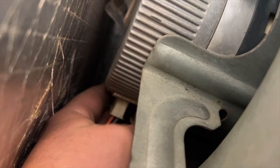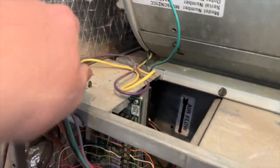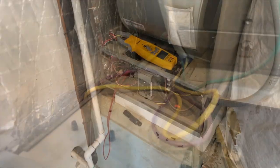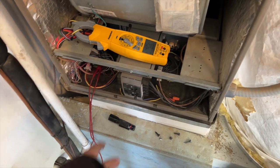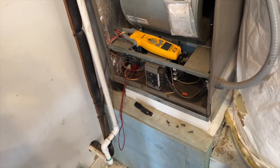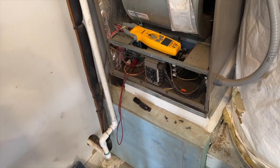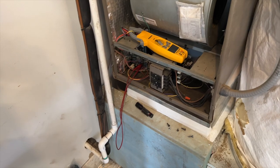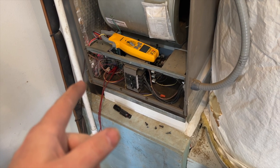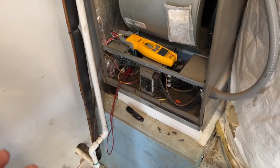Pull out the high-voltage one and it just routes right through here — just like that. Get that new one in. She's in there and seems to be running fine at 4.25 amps — that's because the door's off; it drops down to about 3.8 when the door's on. Hopefully this helps. I'll put a comment maybe a couple weeks later to let you know if this thing actually kept running or not, because I'm not 100% sure it was the wiring harness.